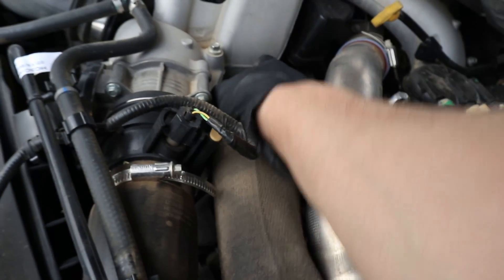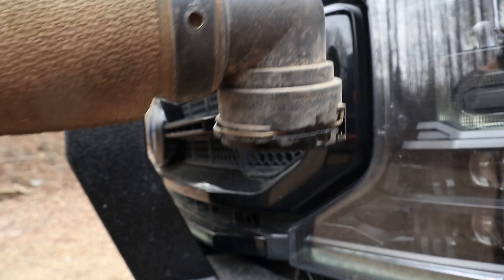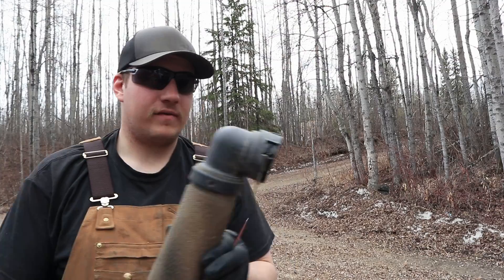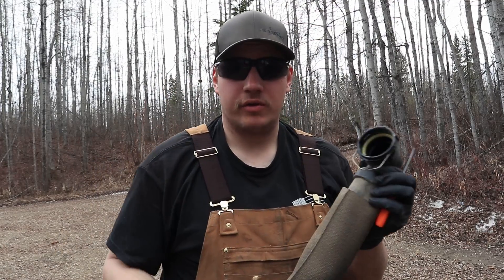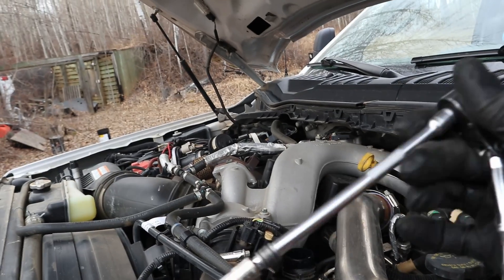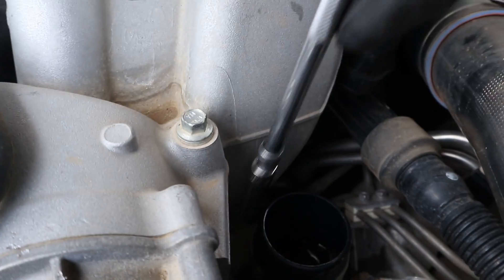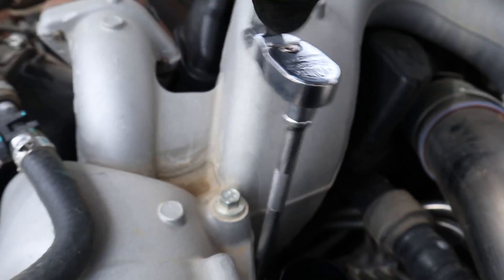Here's that pipe we were looking at from this view. With the thermostat housing right here, you need to come in and just pry this sucker out, then pull the tab completely off — I ended up having to use two hands, it was really stuck on there. When it goes back together, put a little bit of grease in here — it'll make the install go really quick. Now you want a little quarter-inch ratchet and an 8mm socket. Looking at this thermostat housing, you've got three screws — one on the front, one on the back side, and one on the other front side. These should have a little bit of tension to them — you'll hear them pop, and then they should just come out.